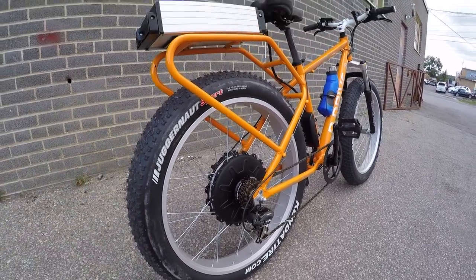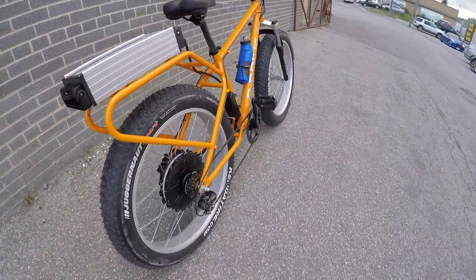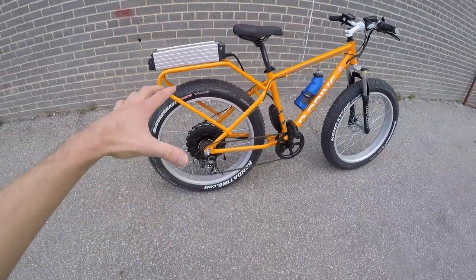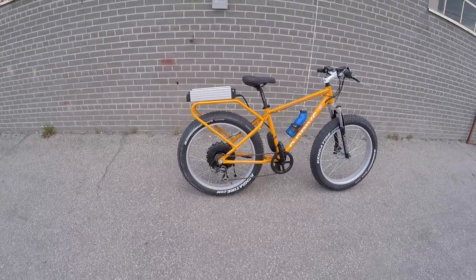You've got these bigger tires here — 26 by 4 inch, where the four inches designates the width and gives you a larger surface area. If you lower the pressure down to around 5 to 10 PSI — they say 5 to 30 PSI on the lower end — they're a lot squishier and comfortable and fun, but it's going to be more difficult for that motor to power you.